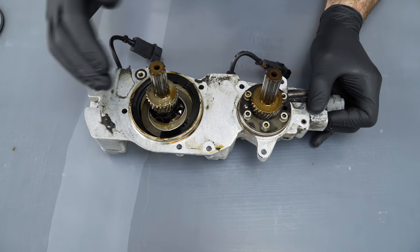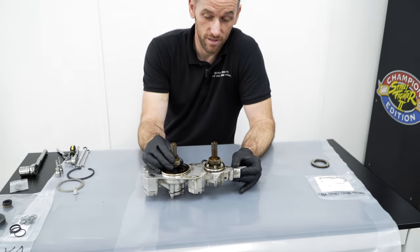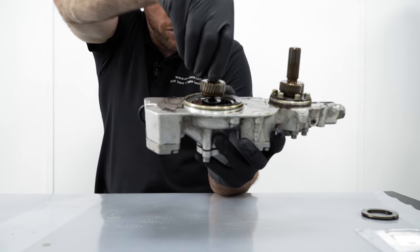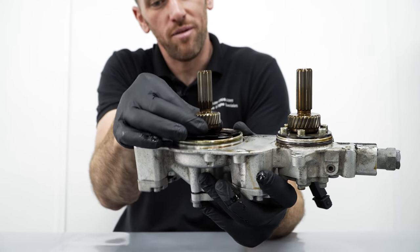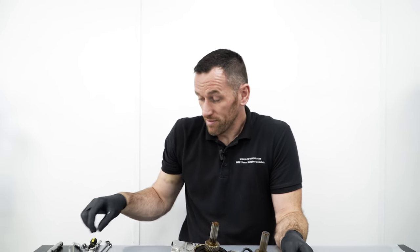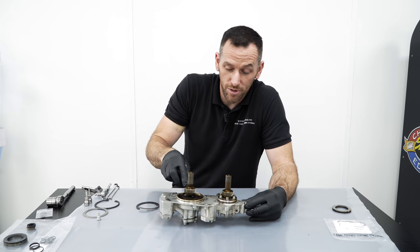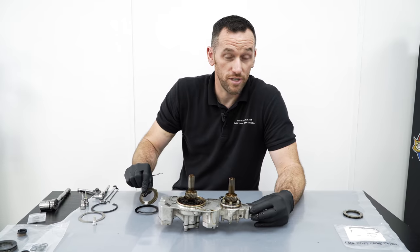Yeah. The clever part is the ECU controlling how it moves and when. But in terms of what this does, it just goes in and out of the gears in the car. There's a helical cut on there, and as it comes out, it rotates the cam as it's turning in the engine. And it is that simple. That's what changes the timing. That adjusts the camshaft timing as it does it. On a double VANOS engine like this, it is infinitely variable, so it depends on RPM, temperature, throttle position. It depends on how much it wants to set the timing, advance or retard it, basically.